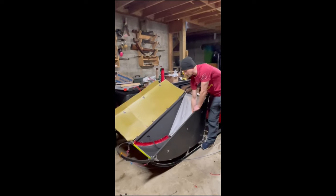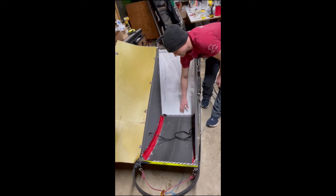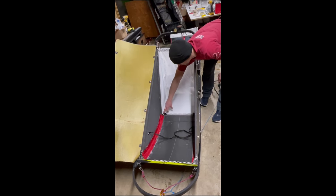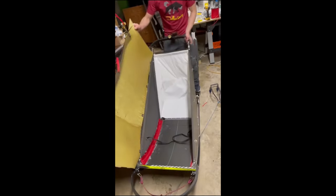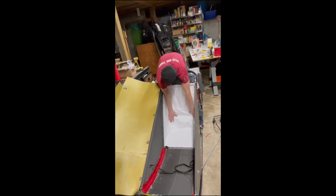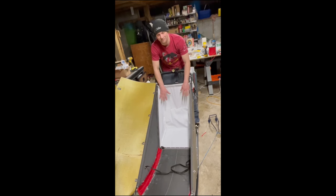Inside, we've got a carbon fiber bed. This bed is carbon and it gets thicker as it goes back - you can see right here there's a major jump. This is where we introduced the foam core, so it's got carbon layers on either side of that. These fancy little brackets are made out of carbon. Heim joints in the corners there, so it rolls the same in the back. The tricky thing is this sled is very flexible, so when you're working with hard panels and flex like that, you either get a big gap when it's flexed one way or it's going to be hitting when it flexes the other way. So the back quarter we convert into a sled bag. For all the seamstresses and seamsters out there, don't judge my stitching - this is structural sewing. It's not pretty, it's tough, it'll hold up.